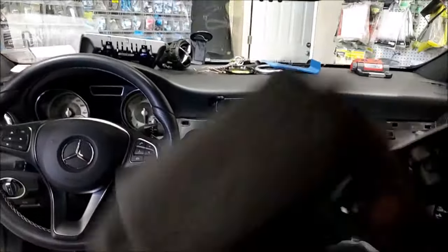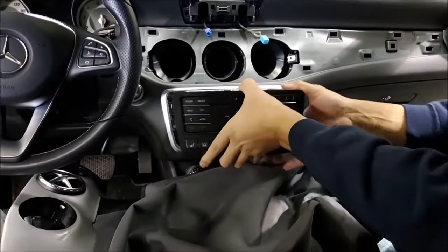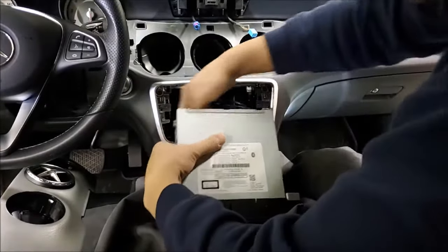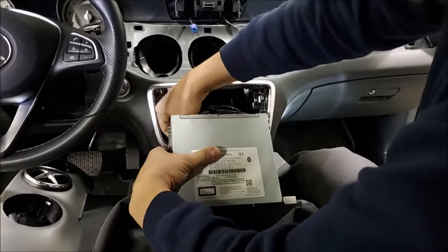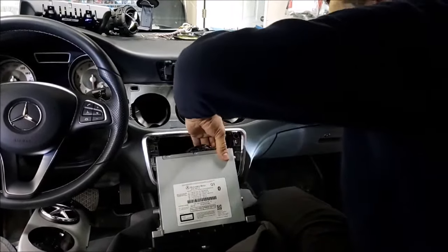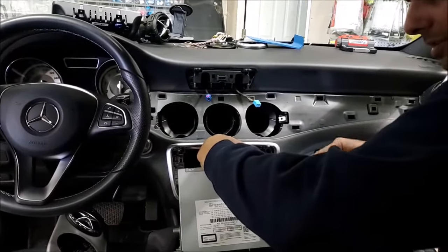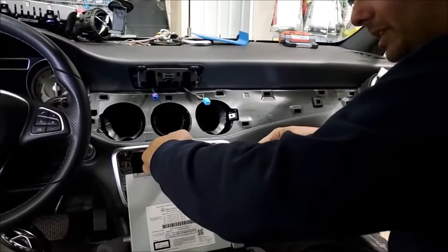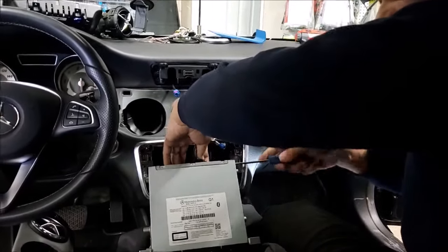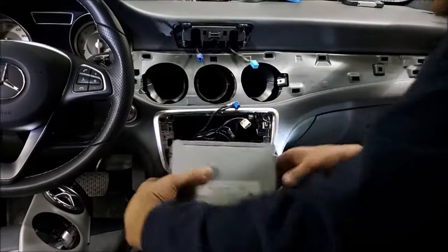We'll put a cover in here, put this back on the seat with the cover to make sure it doesn't get scratched, and lay down the radio. There are a few connectors on the sides and back. We'll take out the radio and that gives us enough room to work on the system we need to install. For the connectors — some of them are a bit tricky — what I do is take a flat screwdriver, press with the finger on the clips, and slightly push the connectors up. Again I put my finger on the clip and gently take the connectors out. They come out very simply, and we have the radio completely out.